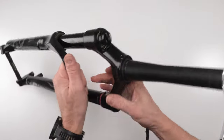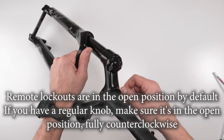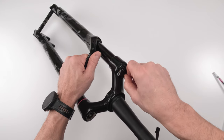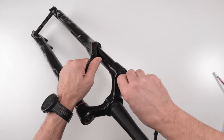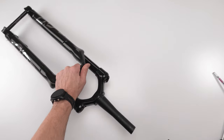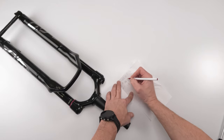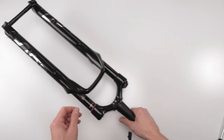For low-speed compression, turning counterclockwise we count 14 clicks. Now let's take out the rest of the air from inside the fork before opening it. You do not want to open up a lower while there's still air inside the air spring — it'll pop on you. Grab a small paper towel and a 3.5 to 4mm Allen key, place the towel over the valve, and depress it. Air pressure will force oil mist out and the towel will absorb it. Push down on the whole fork all the way to the bottom, let it come up, and repeat to make sure all air is removed.